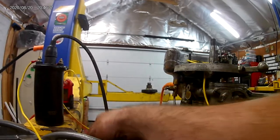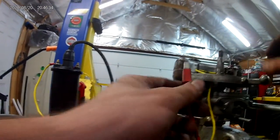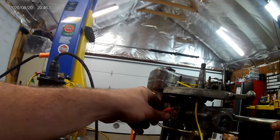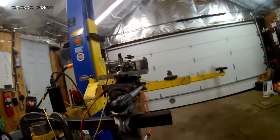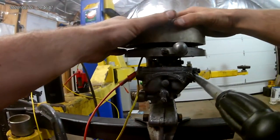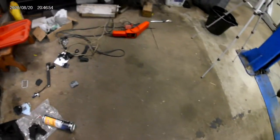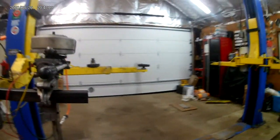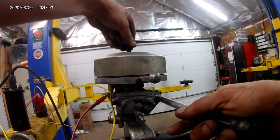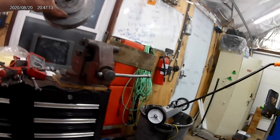I'll give you guys a little demo. I'm going to hook up the ground side — keep it disconnected for now because this coil gets to be approximately the temperature of the sun. I'll put the ground on there and put the flywheel back on. I was actually able to dial this in with a regular old timing light — probably from 1992. I don't use those much anymore but I still had one kicking around. This is my backup flywheel; it doesn't have the recoil. The original flywheel is right here for whenever I get it fully dialed in.